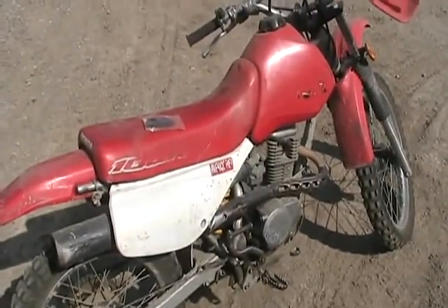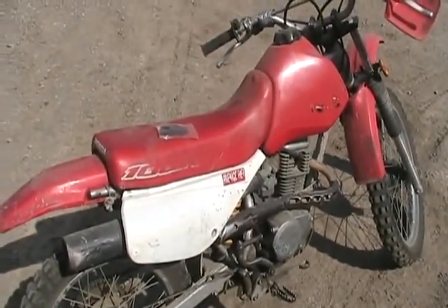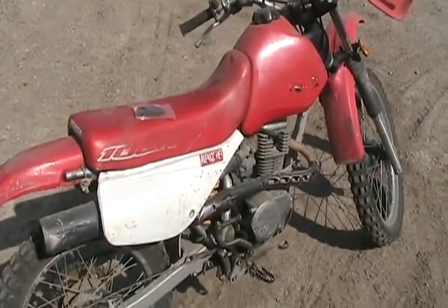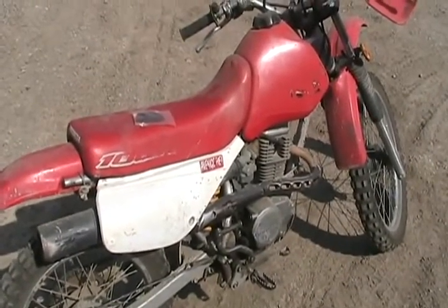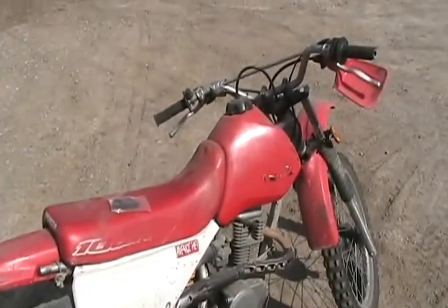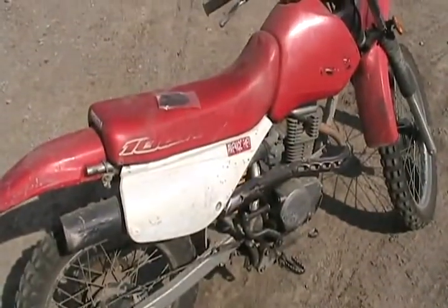The chain in this thing has flipped a few teeth because it's so loose and worn, so they're very difficult to take out. You've got to split part of the crankcase, take the flywheel off, and that takes a special puller tool. I'm a lazy redneck some days on a sunny day like this - I'd rather be drinking beer and riding than tearing a block down.